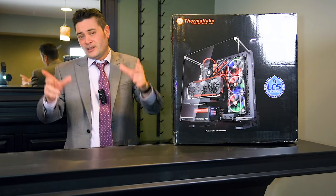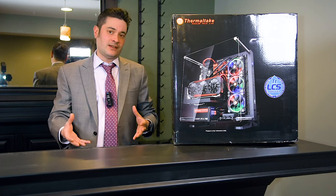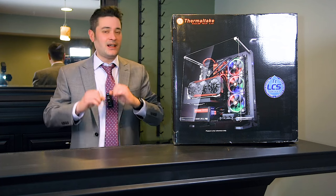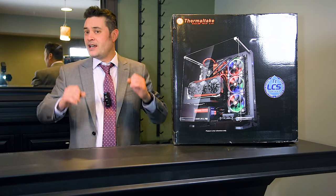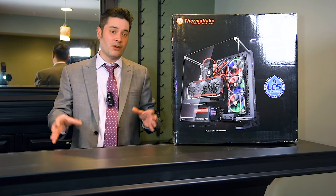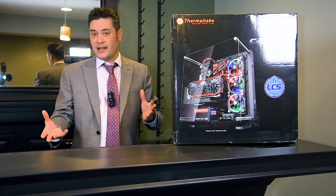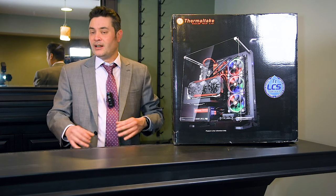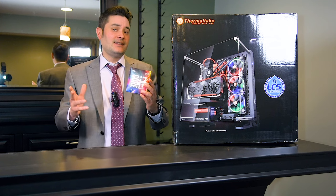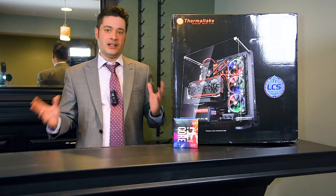Now, let's talk about the processor. There's many choices today with AMD, with the Ryzen, and I don't wanna get involved in that, but I will say this. I have a 6950X for content creation and for video games, and it's a lot of fun, and it does it really well. For this job, and what we need to run the audio and video with Serato and Virtual DJ, we're gonna want a higher clock speed per core, rather than more cores with less clock speed. So what did we select? We basically selected the Kaby Lake i7-7700K unlocked processor.